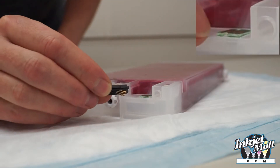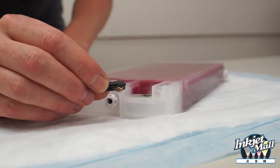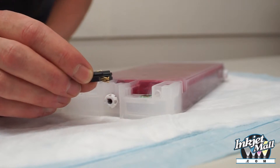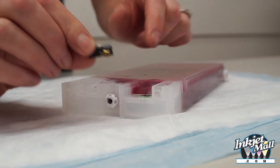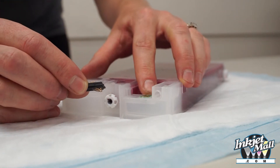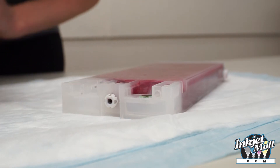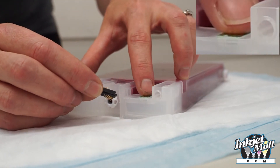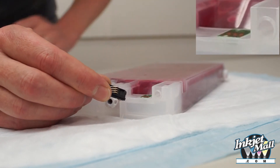This chip isn't flat and flush. This is the chip sensor which is inside your printer's cartridge chamber. The thin sensor wires can be easily damaged if a cartridge is installed with a chip that's not flat, or no chip at all. Pressing the chip down so it's flat will allow for good contact with the sensor and prevent damage to the sensors.